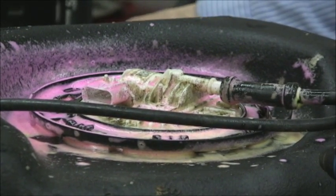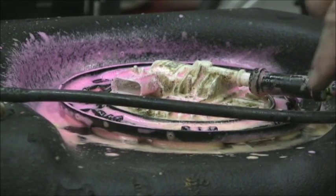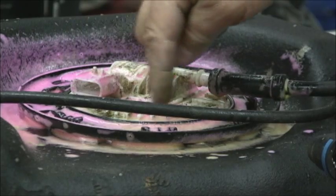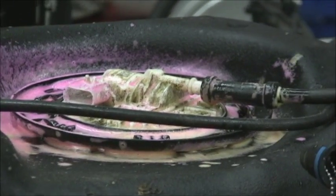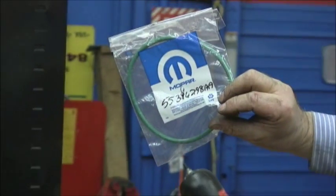Just give it a little more — you're going to see all this pink here turning into yellow. The spots up here where there's no CO2 coming out, they stay pink. I messed up the gauge by getting all the stuff on it, but no problem. Right in here you can see all the yellow. So I have a leak. And this has a new seal in here, a new O-ring from Chrysler — it's been installed there — and a new locking ring has been installed on this tank.